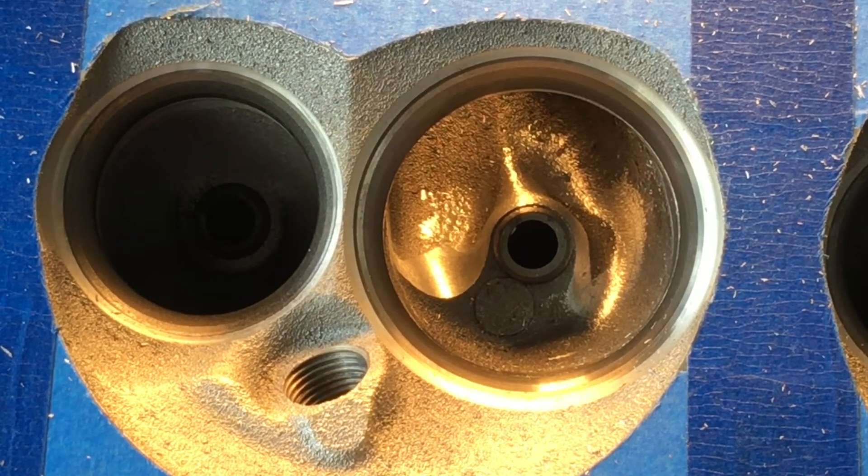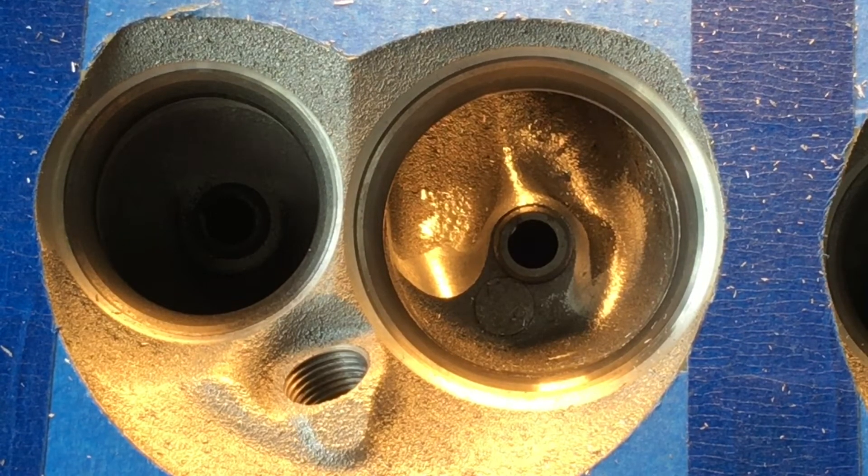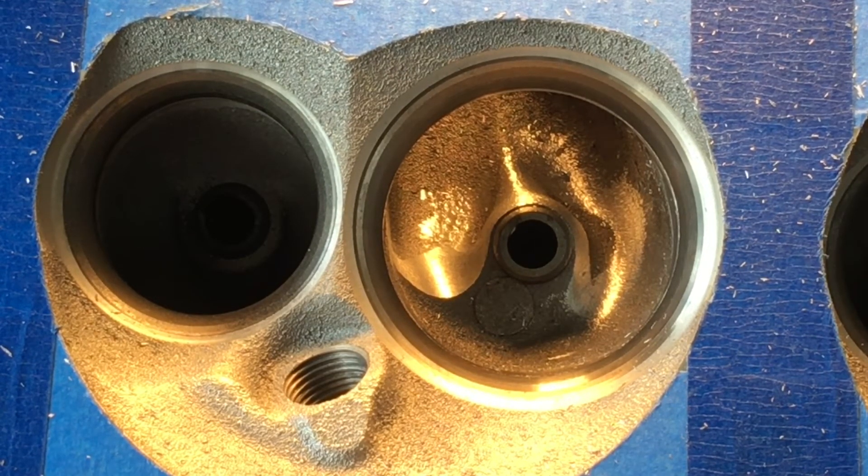Having the right tools and the right cutting burrs is a huge advantage. You could still do this with just a simple double cut burr, but you'd have to be careful and keep good tool control. Don't get frustrated. If you get tired, antsy, or impatient — all those are bad words when it comes to cylinder head porting — take a break, walk away, do something else, and come back. You don't want to get in a hurry when you're porting on a cylinder head, because it'll bite you in the butt every time.